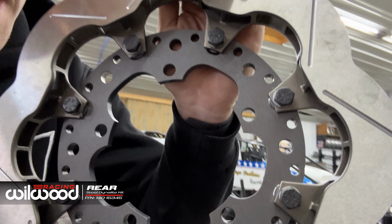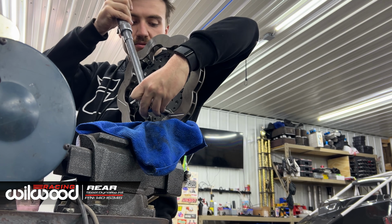All right, so now I have my bolts put in. They're just hand tight at the moment with red Loctite. It says Loctite 271, but that's all I have. Next we have to convert it to 220 inch-pounds for the bolts, to be torqued up in a star pattern. I should have known, because it's the same as a fine thread, 18 foot-pounds. So we're going to torque these to 18 foot-pounds in a star pattern.